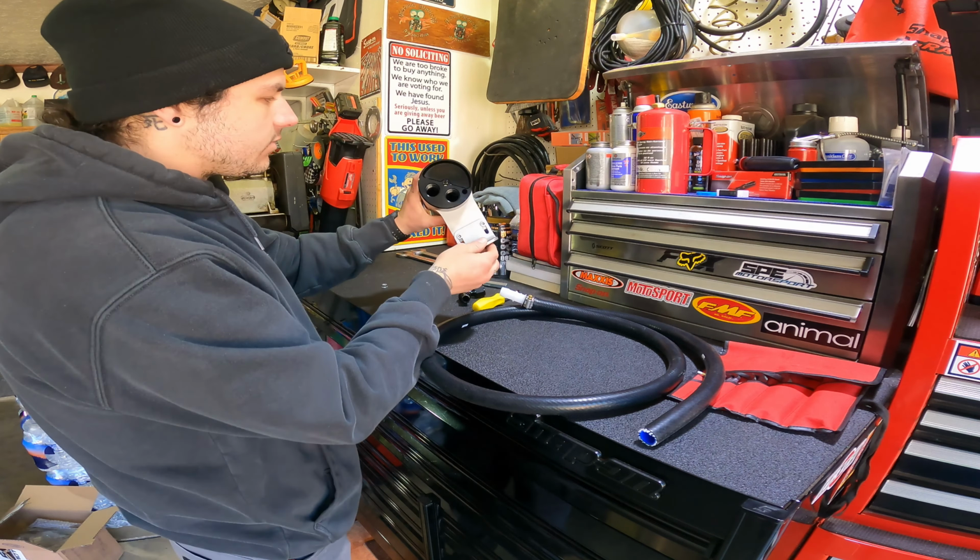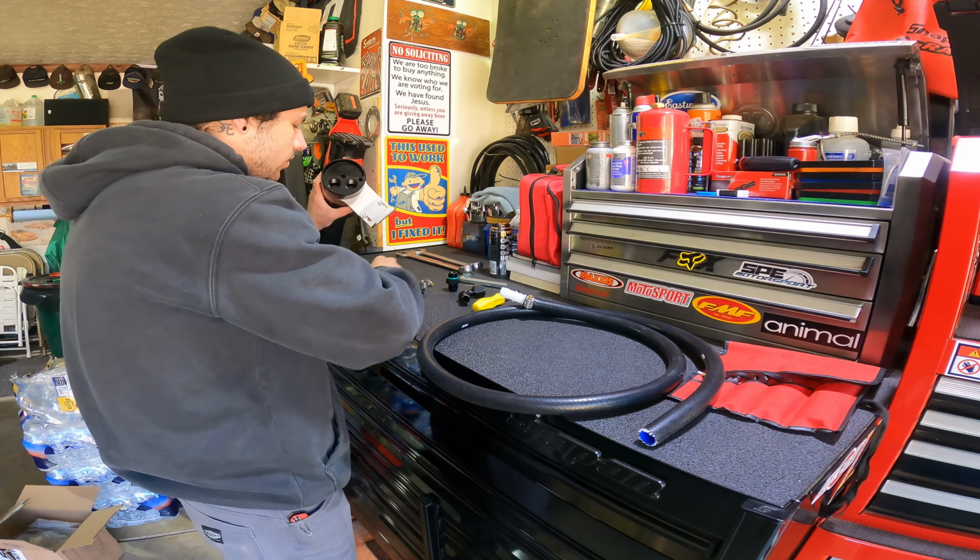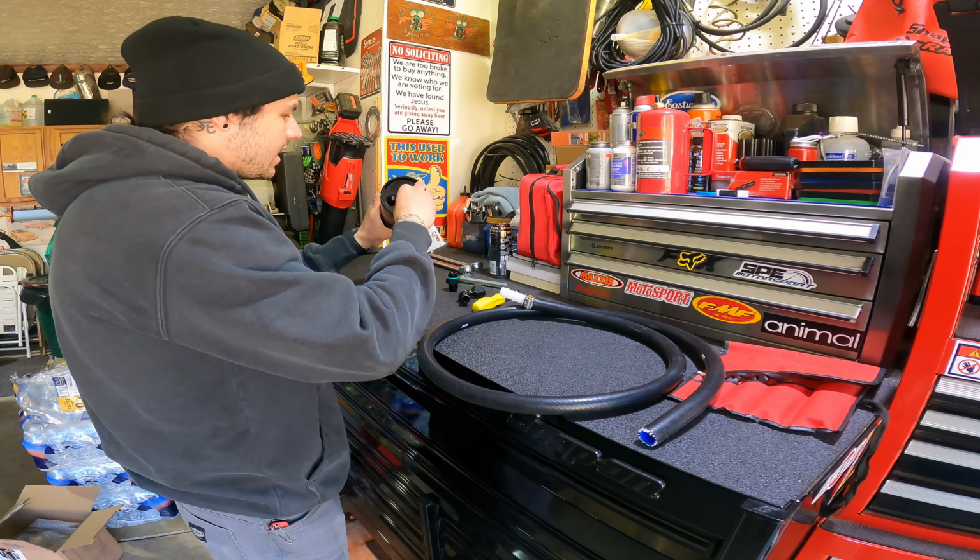So the way you got this right here is you're doing your plug right here, which is a 9/16 Allen. There's an O-ring under this. Make sure the O-ring's there. It's O-ring seal. You got this guy right here comes in with an O-ring on the one side, other fitting on this side. So we're going on the left side. O-ring, and I'm not tightening anything right now. I'm just kind of mock fitting.